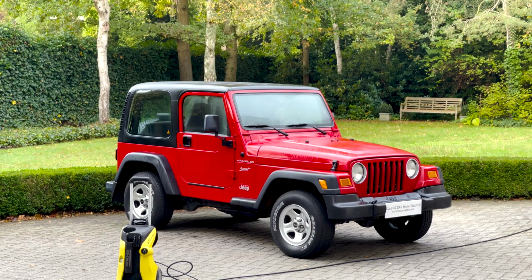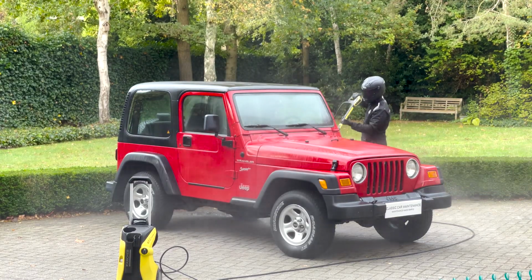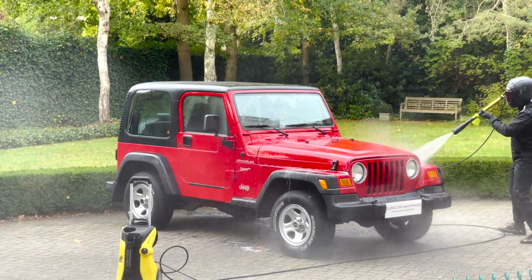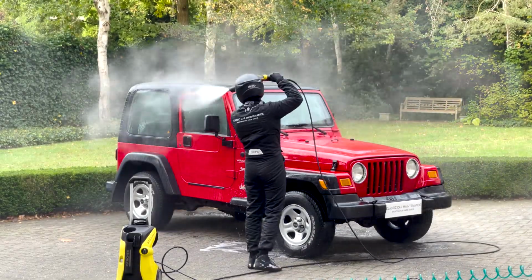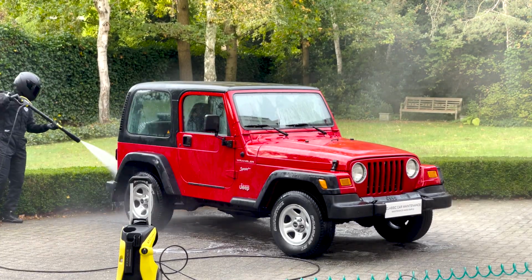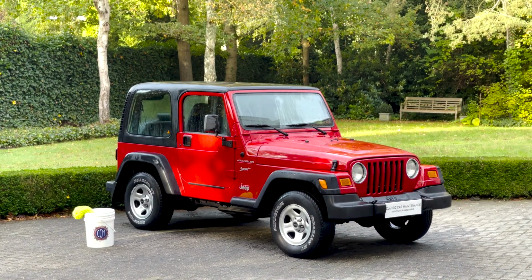Now, rinse your car thoroughly with your pressure washer before the iron remover dries. You want to hit the surface from a minimum distance of a foot or so and work in a 45-degree angle to blast the particles away from your car paint. Avoid working in a 90-degree angle because the high-pressure water jet will actually shoot any dirt and grit on there with full force onto the car paint. The idea is to clean the car, not to sandblast it, right?